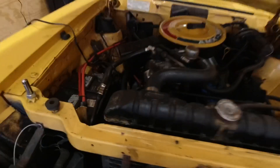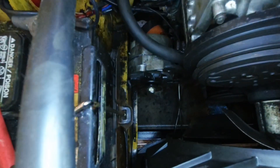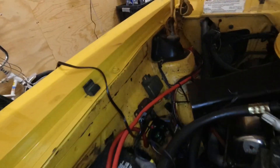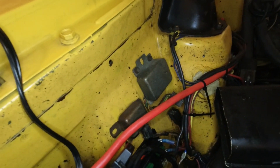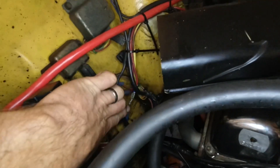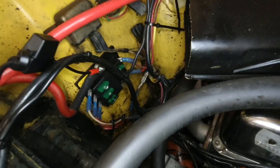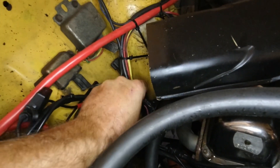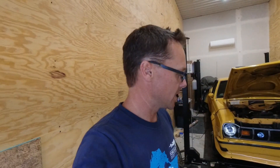New plan. I have the one-wire alternator in there and it looks alright, but it's huge and it actually hits the oil filter, which I didn't plan on. I thought about doing an oil filter relocation but then I was like, what am I doing? This is stupid. So I'm going to ditch the GM1 wire. I just ordered from RockAuto a new alternator that's the AMC one and a new voltage regulator. When I took the old alternator in to be tested, they said it was okay but the brushes were 60-70% worn. Then I found this connection was actually undone and just barely touching - that's power for the ignition system - and the battery ground is loose too. Probably wasn't the alternator or voltage regulator at all.